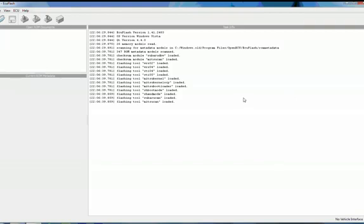The Evo ECU is a flash-based ECU in which the settings for the ECU are stored in a ROM image file. The image file has to be downloaded off of the car, edited externally, and then flashed back to the car in order for the settings to take effect. In its stock form, you can't live flash an Evo and have these settings take effect while the car is running. You have to do this while the car is turned off. Makes tuning a little bit more difficult, but there are some developments being made that will potentially allow live map tuning in the future.